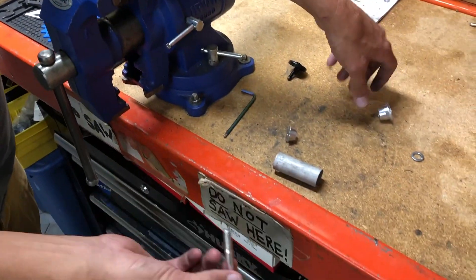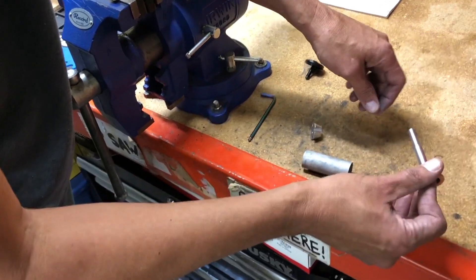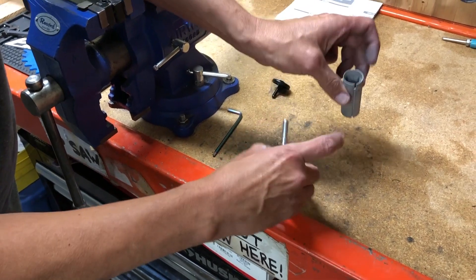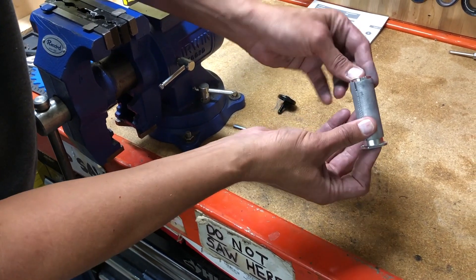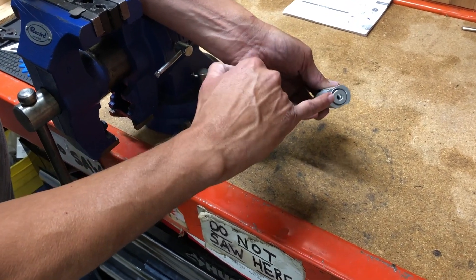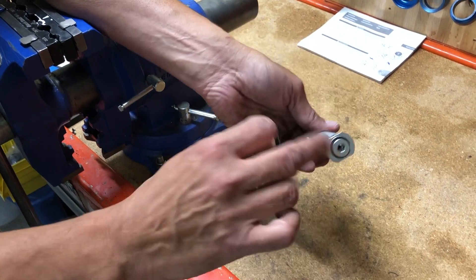Kind of pre-assembling this thing — this is on a North Rock, has Fuji parts. We've got a little wedge part, a little shim piece, and the convex ends. That goes into that; we can drop this down into the steer tube. Looks like a six millimeter hex key — tighten that and fix it into place. Ideally the stem is going to be slightly above this so that way the plug doesn't bottom out against the cap.